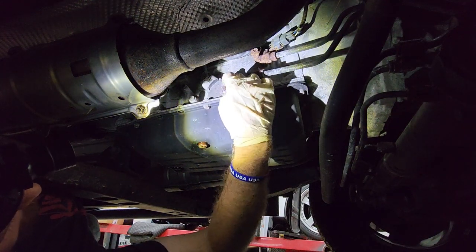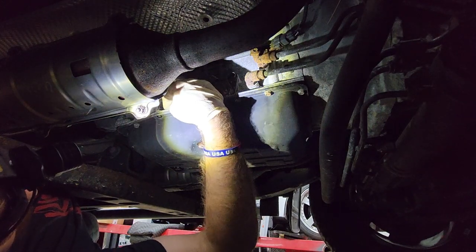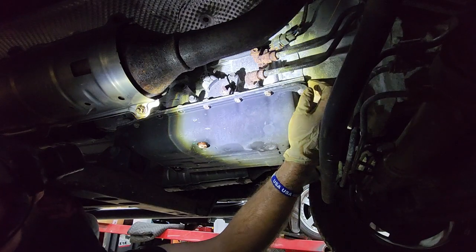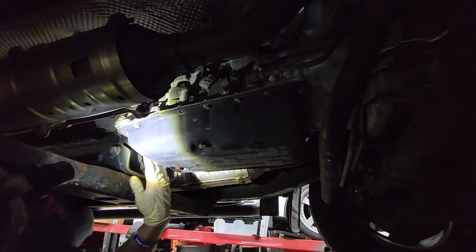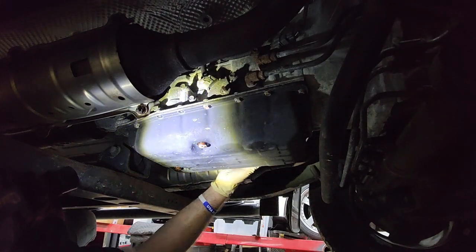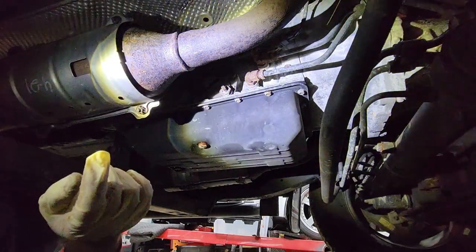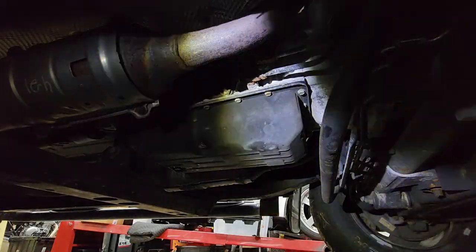All right, so the holes are through holes, so we can spray some penetrant on the top here to get at least the side ones. No guarantee on the back ones, but since they're not open, I bet the corrosion hasn't seeped in, so they'll probably break loose like these two did real easy. So I'm gonna grab that and keep going.